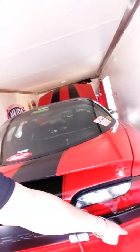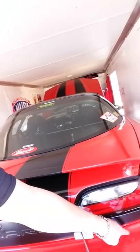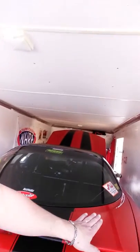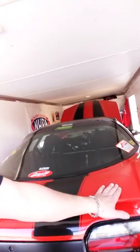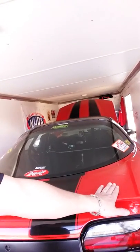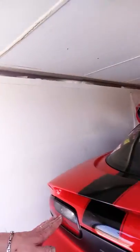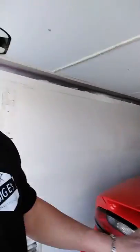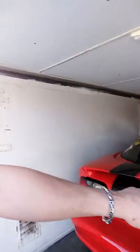So you want to put more air in this airbag than in this one. For any car, if you put airbags in, you're going to want to put anywhere from 10 to 15 pounds on one side. I like to split the middle, so I put 12 pounds of air in the airbag over here, and 5 to 10 over here. I like 7. So now you've got it staggered. When that thing torques over, it's going to take the weight from over here and shift it over here. When you hit the loud pedal, if you have that 5 pounds of stagger from left to right of air pressure, that car should leave straight.